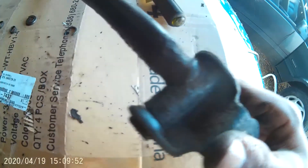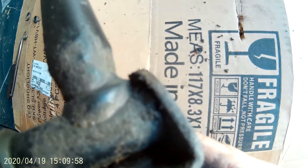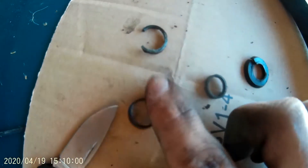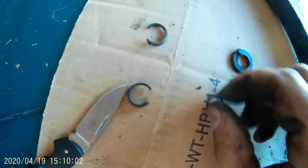One of the pins that holds the front part of the U-joint onto the shift rod actually doesn't come out, and I think it's been done like that from the factory. Those are supposed to have bronze bushings in there. Since you can't take it out, you can't put bushings in it. So I devised a plan to merely chop my rubber bushings into pieces, cut a slit in them, and slip them over the rod as shown here.